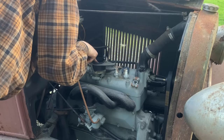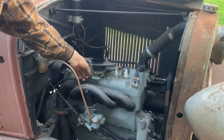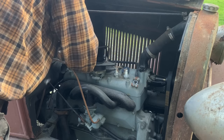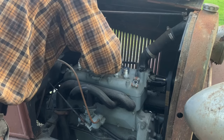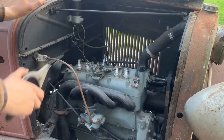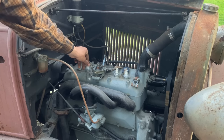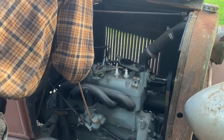I'll spray some oil in here, put a whole bunch of oil in here to try and help oil the top end. And I have to replace one of these that just blew off on me, one of those little straps. There's no advance retard link here. I feel some spring resistance. Must be the old bottom cable is getting a bit stiff. So I'll check this gap.